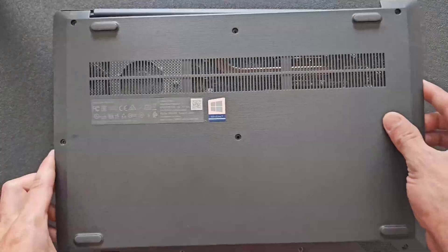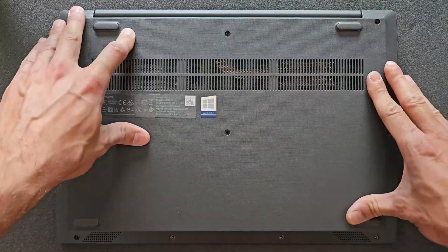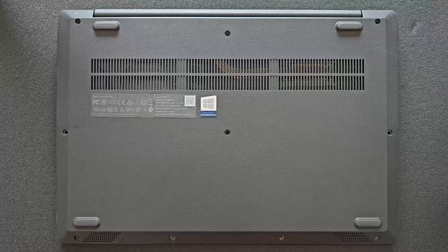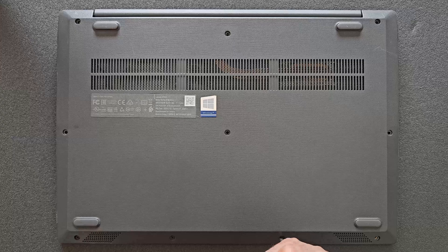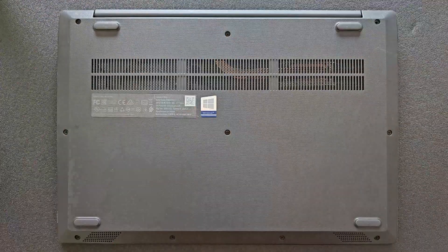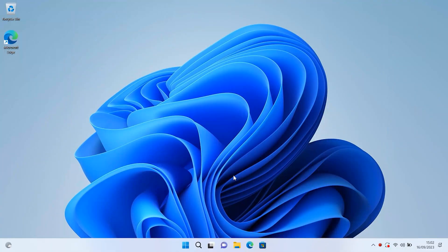What's left to do now is close the back panel again and that's it — upgrading done. We're going to boot into Windows now. Once the back panel is on I'll show you the specs. There's going to be 20 gigabytes in total because the 16 gigs we installed plus the 4 gigabytes already on the board — the 4 gigabytes are not removable, they're soldered to the motherboard. So with 16 gigs in the one slot, the total is 20 gigabytes of DDR4 RAM plus a one terabyte SSD.